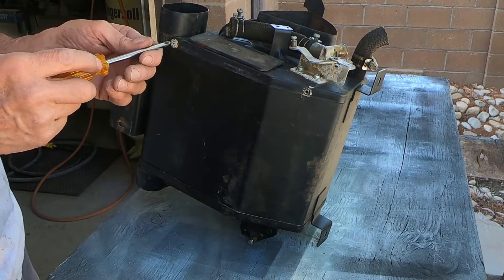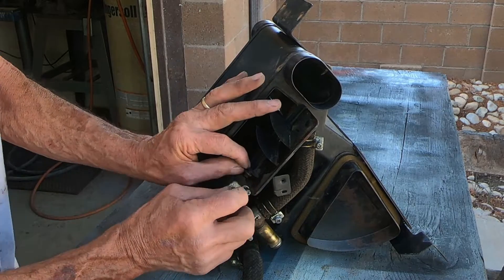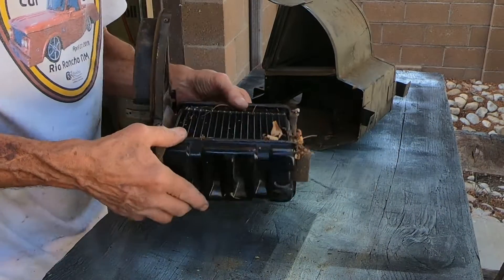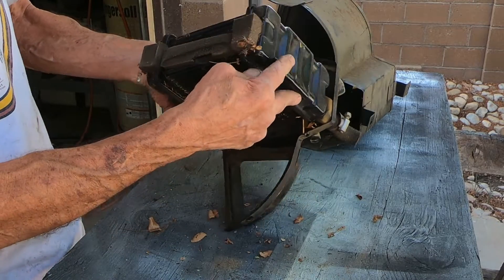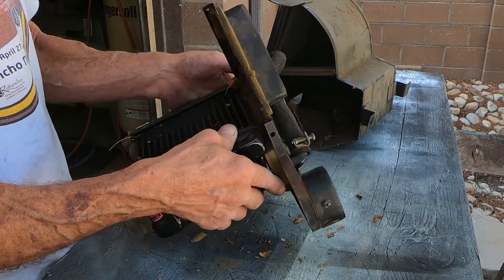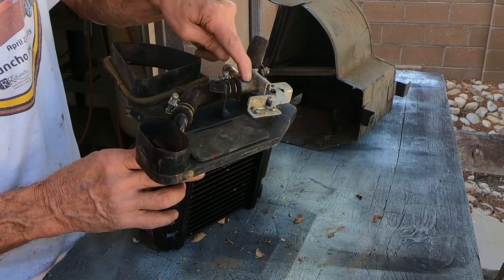So maybe it's leaking out of the control valve and not the heater core at all. Actually, the heater core looks really good - I don't see any evidence anywhere that it was leaking. But I'll stick it down in a bucket of water and blow some air through it and pressurize it to about 5 psi to see if there's any leaks. That will also identify if there's a leak in the valve here.